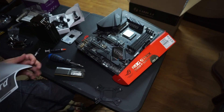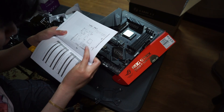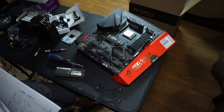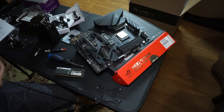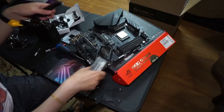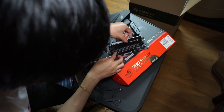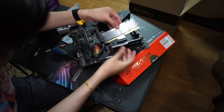There's a CD? Seriously? I don't use a CD anymore. Alright, so what we're looking for is the RAM layout right here in the manual. In some motherboards they would have A1, then B1, then A2, then B2. But this one is A1, A2, B1, B2. So for the new RAM I'm going to put it in the A channel because that would be the first one. Installing RAM is easy - you just pop it in there. Just follow the indent and that's pretty much it. There we go, perfect. And now this goes on this channel.